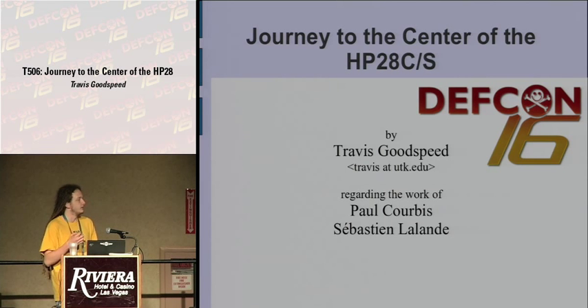From that starting point, they dumped out the memory through a piezo buzzer — one full second of buzzing for a one, one full second of silence for a zero — recorded this to tape, fed the tapes into an Apple IIe, and with this memory dump, started looking through it trying to recognize things. For example, they'd look for 314159, and that would be pi. Seeing pi, they could go backward and figure out how all floats work. Then they began to inject things into memory, create new objects, and mess with the operating system.